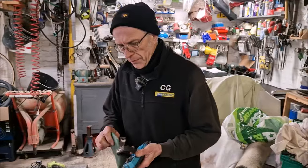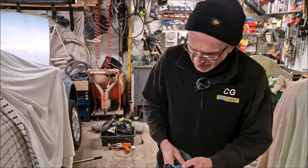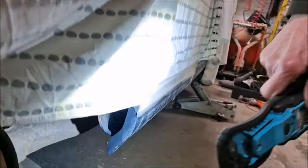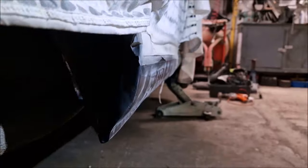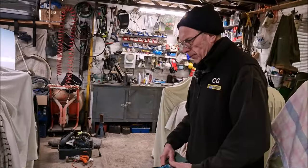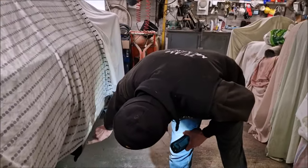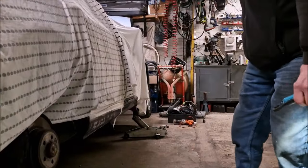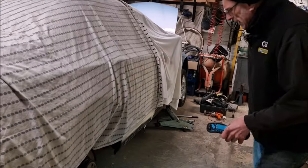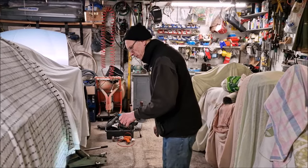What have you discovered? Have you had to fabricate something totally brand new, or have you used the new sill panel? I've used that sill panel as best as it is. I've welded a bit on the end so it's kind of — let's have a look. Shine your light on it — yeah, it looks like a sill now. Oh, that looks good. I've just got a piece of the sill, bashed and bent it to make it something like the right profile at the bottom, and welded this on the end so we've got an end to the sill. I've put a guide coat on it to make sure there are no high spots before I put some filler on.